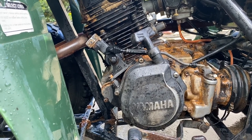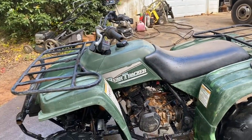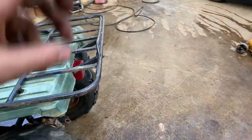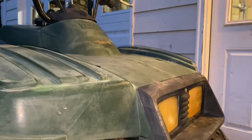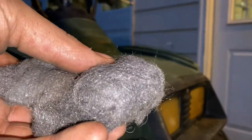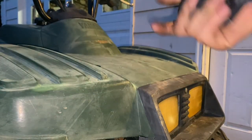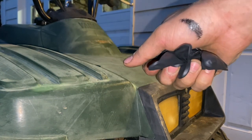This quad is not meant to be perfect — it's a cheap beater. I'll just throw some paint stripper on it every time I wash it and slowly get that fixed up. For the plastics, we're using Purple Power and then triple-zero or quadruple-zero steel wool — the finest you can get. I'm wearing gloves because that Purple Power will dry out your hands pretty badly.